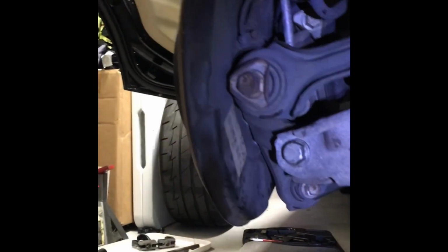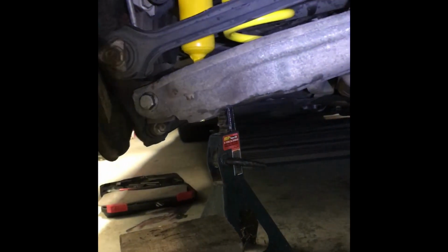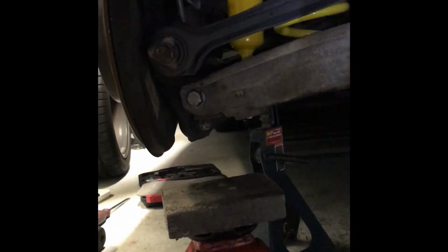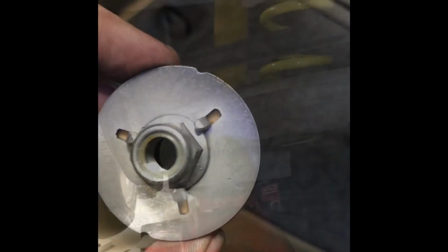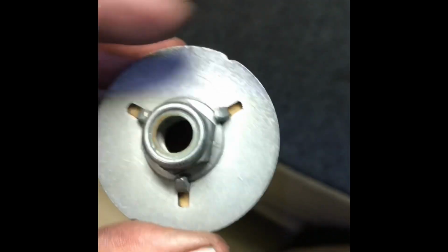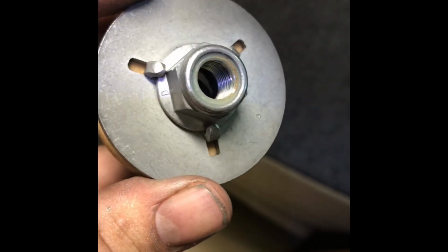You guys don't need to see that. It will be necessary to raise the control arm a little bit in order to get the nut on. Just a hair. The shock, once it's installed, actually controls how far down the control arm can drop once you jack the car. The top mount nut and bump stop assembly has this captured nut. You can bend the tab and install the new nut, or reuse the old one. I'm going to reuse the old one.